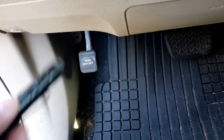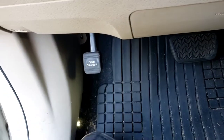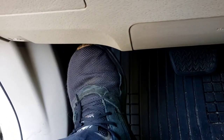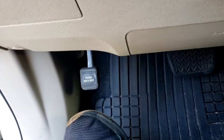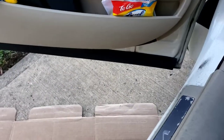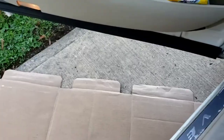To release it you push it again and it comes off. But if you notice, this one is not working right — there's no more click click. It usually goes click click click, and the harder you push it the further it locks down. But this one is not doing that. With the car off you hear a little squeaky sound.